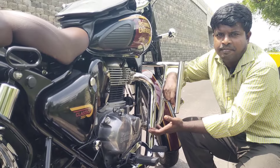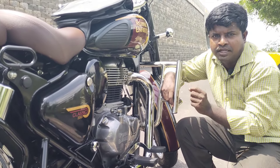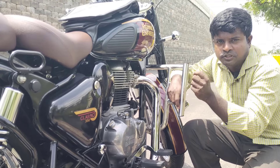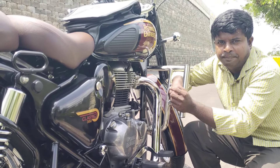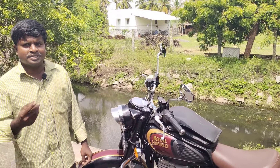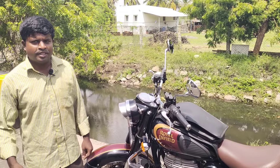This is the gear section. The gear section is 7.90 mm. The shifter fork is 7.90 mm, and the second shifter fork is 7.80 mm.